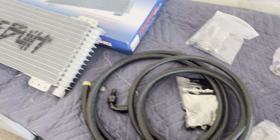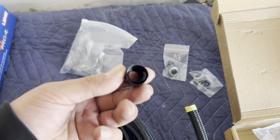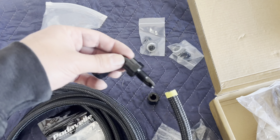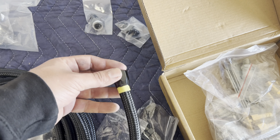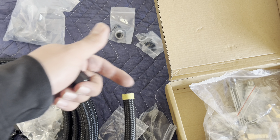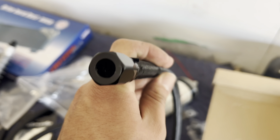To install the AN fittings, the way I do it is spray a little bit of lubricant on here. This piece you're gonna slide over, and once that piece is over you're gonna slide this piece in. Start off by putting this part on — there's already tape here so we're gonna try to use that, but if not you want to wrap a piece of tape, it'll help.